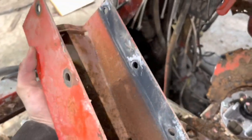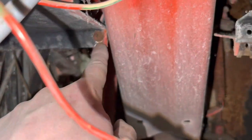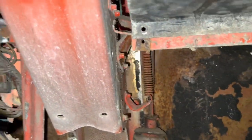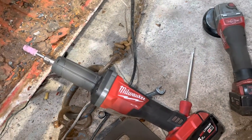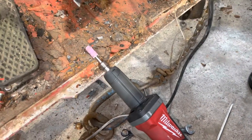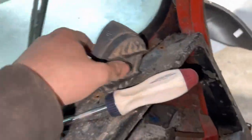This outer piece is on show, so I'm going to sandblast it and it'll get painted metallic orange like the brake pedals and the rest of the cab. With that out of the way I can get a die grinder on that stubborn screw head — not easily, it was a pain, but doable. I used a die grinder with a grinding stone I'd normally use for smoothing cast iron after rough porting cylinder heads with carbide bits. I've got all the top screws out; there are still some at the bottom holding it in.